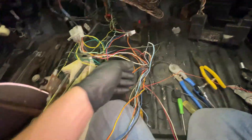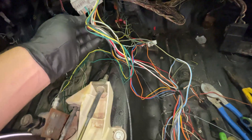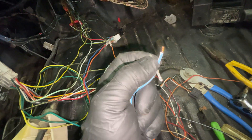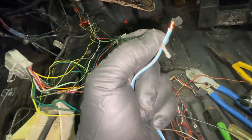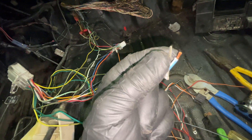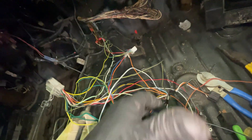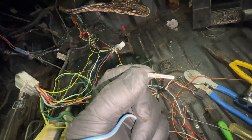I've got a couple things sorted out — I've been depinning wires, rerouting them, and plugging them back in. Here at this connector I started depinning some of the mess behind it, and while I was in here I did a little more than depin. So now I'm going to stretch this pin open and try to re-crimp it — I do have a crimper for that. If I can't, I'll make a mental note, take pictures, make sure this pin goes back into the exact same slot, and order a new pin — probably a hundred of them, since this might not be the last time it happens.